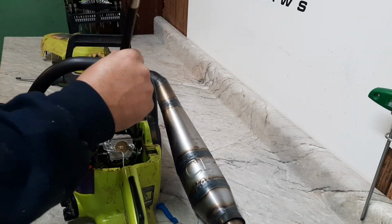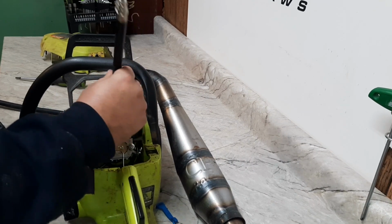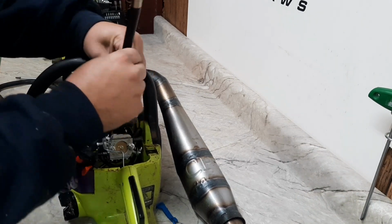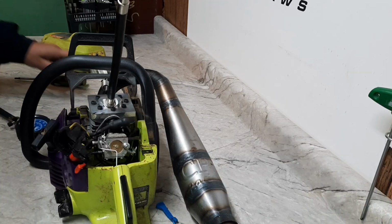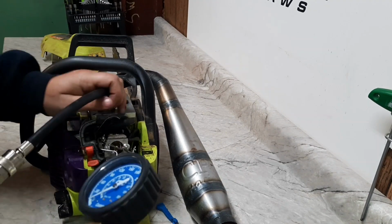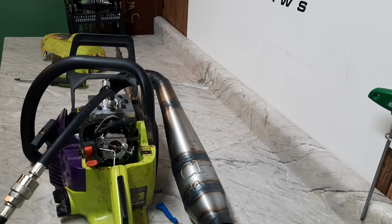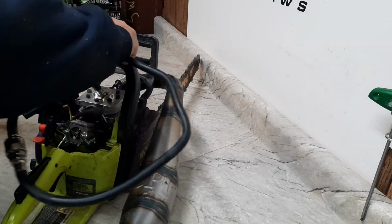Pretty sure when I redo this head, I still want to keep it angled. That way everything fits under the covers. But I'm going to have to go down to a 10mm plug to get the volume I want. Now it could just be because of the crazy high exhaust, it might actually be trapping some compression up there. I don't have high hopes of this making a bunch of compression. But we'll yank it over a bunch of times, see where the needle stops. This is cold, out of the car.